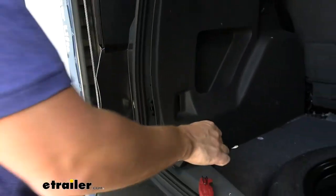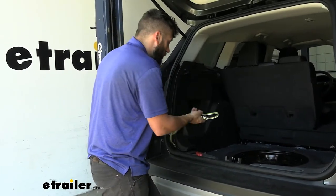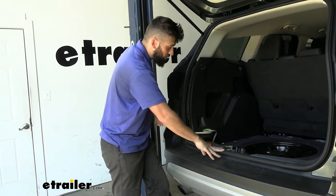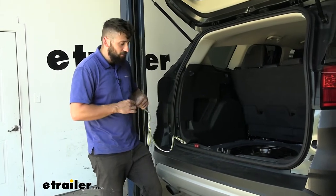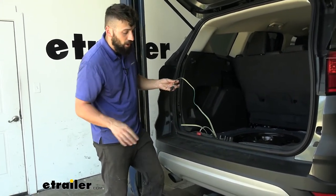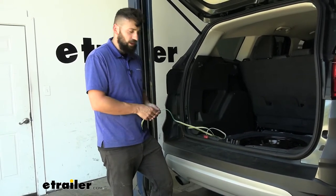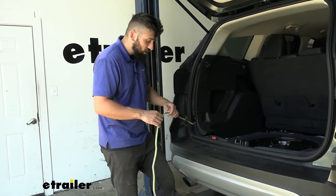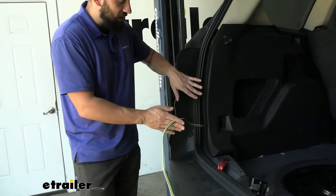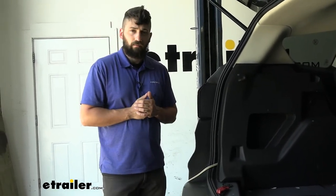Something else we're doing — not required — is regarding the actual trailer connector. Normally, as the instructions state, our trailer connector is designed to just sit inside the vehicle — you ravel it up, tuck it in, and when you need to use it, drape it out the hatch; it's secured by the weather stripping there. That works fine, but it doesn't look the best — you're going to have this wire dangling down on your bumper. If you want to get around that, we're going to show you how to route the trailer connector underneath the vehicle and secure it to our hitch. To do that, you actually need to cut these four wires and splice them back in, preferably so our connections are inside the vehicle — closer to the converter is where we'll cut. Then route the wire down through the grommet and reconnect everything underneath. You'll need four blue butt connectors for this, which are not included with your kit.